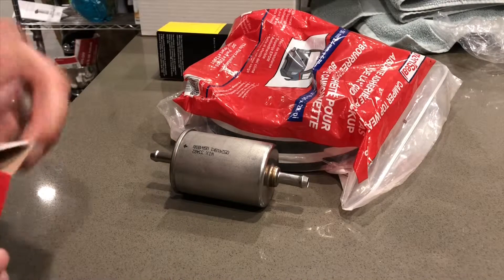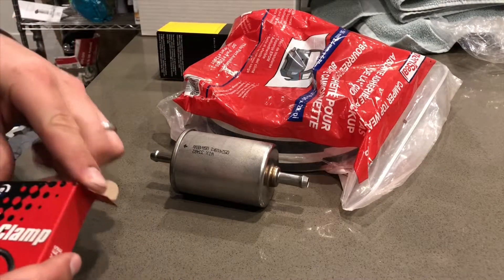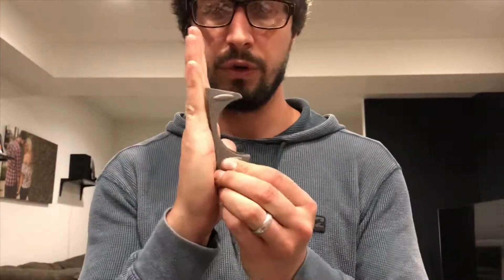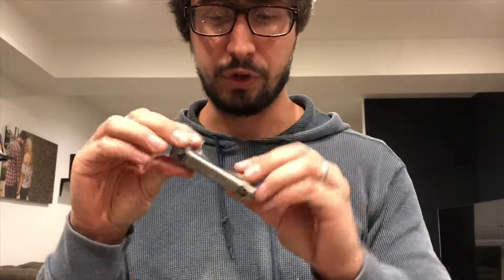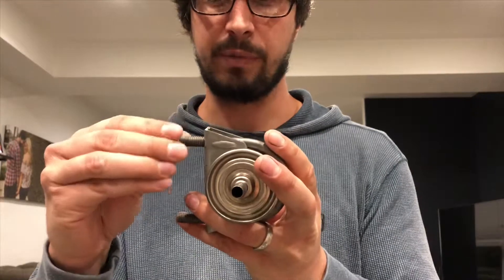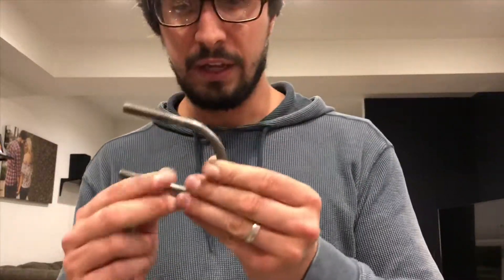But then I got to thinking, what if I used this guy right here? Here's my idea: a clamp for $2.99 that will mount to the frame. I can use this as a template to drill my holes, place the fuel filter like so, and on the other side these will be captured by the frame, the nuts will go on and hold it in place. However, the issue is I don't want this rubbing directly onto the fuel filter.